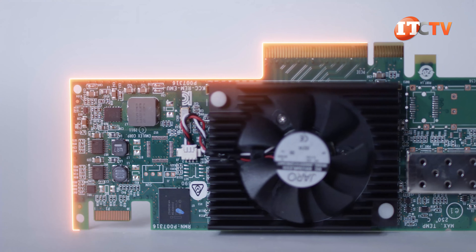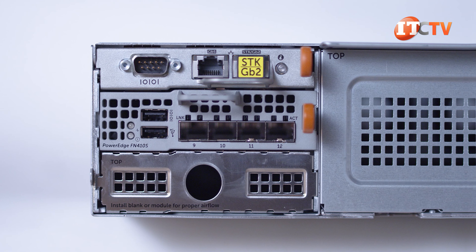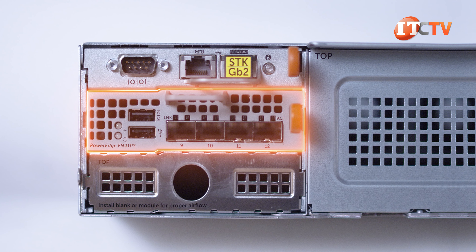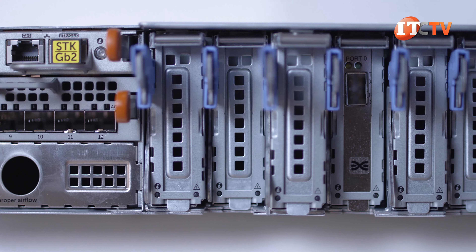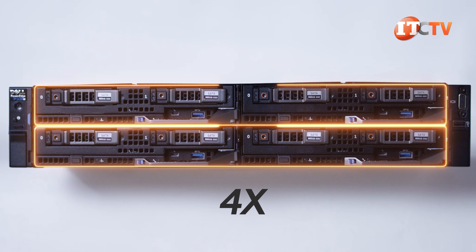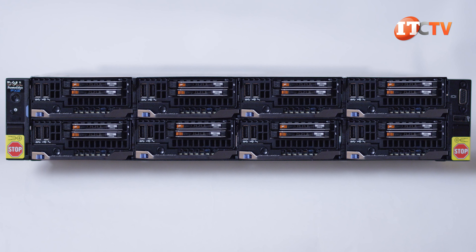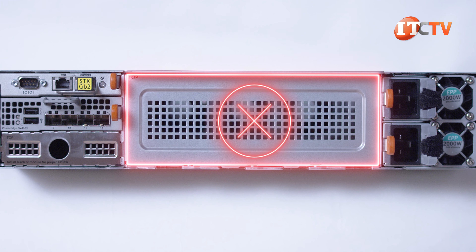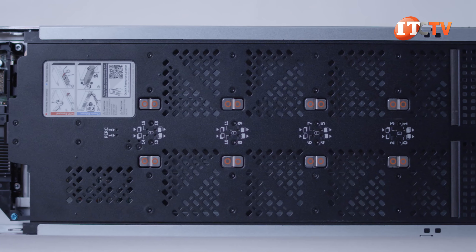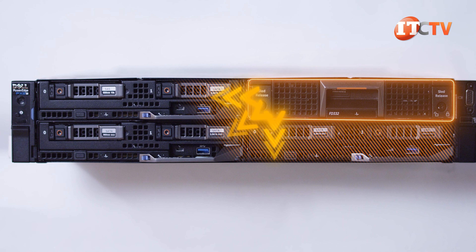You can install network daughter cards offering 10-gigabit Ethernet in either a two- or four-port module. The FX2 chassis offers a cost-effective option with the FNIO modules on the back that automatically map ports to the server node sleds based on width and type of FNIO module. Each compute sled is also allocated a certain number of PCIe slots: the FC830 full-width chassis gets four of the eight PCIe ports, half-width sleds like the FC640 get two ports, and the FC430 gets just one port, hosted in the FX2S chassis. If you install an FD332 storage module with up to 16 2.5-inch direct-attached drives, the PCIe slots reserved for the front base slot will be distributed to other installed server sleds.